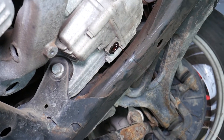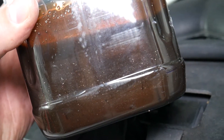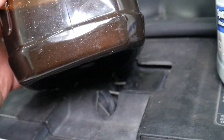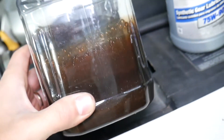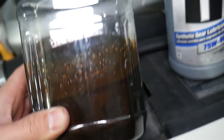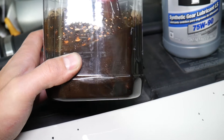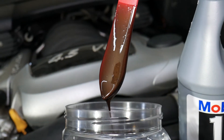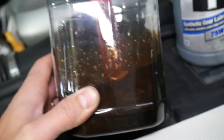This is the container — you can see layers of metallic material stuck inside that oil, like fine shavings of metal. Check it out — that's metallic shavings, definitely a bad differential. There is something bad inside, a bad bearing. It shouldn't be like that — it should be just clear oil. Let's come over by the wall and check out how bad it is. Definitely a bad differential on that Porsche.